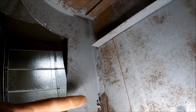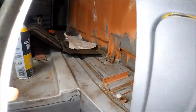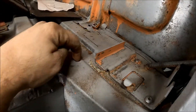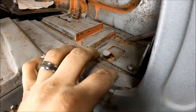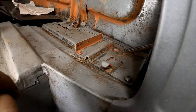We'll be taking out all these spot welds all up in here and throughout here, and then up top we'll be doing the same thing just along the edge. I'll end up cutting this along the line of the old one, and then cutting the new one about here, just tucking it under and welding it down.